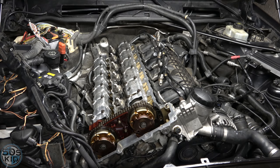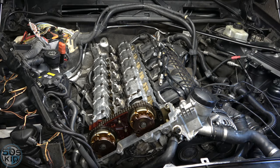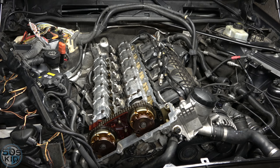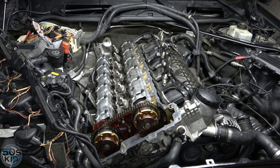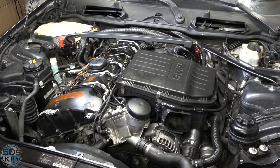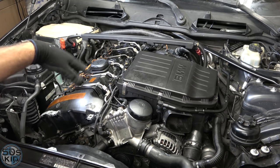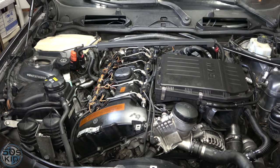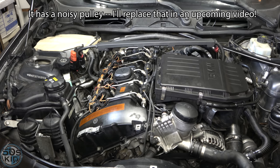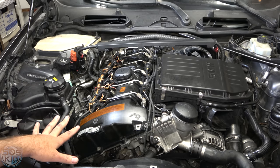I got the crank pin out from above without getting on the ground — easy to take out, not easy to get in. I do have to go underneath to plug the yellow plug back in. All right, we are back to where we started and all done with this job. I had the fuel pump fuse unplugged because the fuel pump likes to turn on randomly with the battery connected. Plugged it back in — now I can definitely hear the clicking, but no leaks — no fuel leaks either. It's quieted down just a little bit.